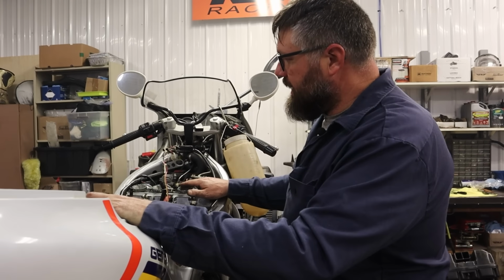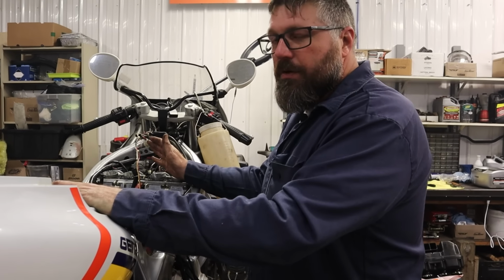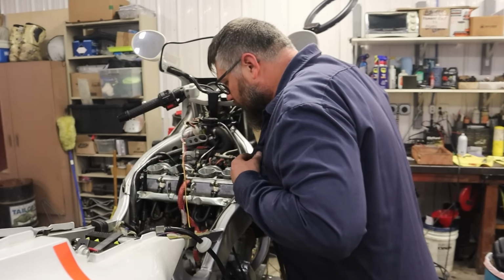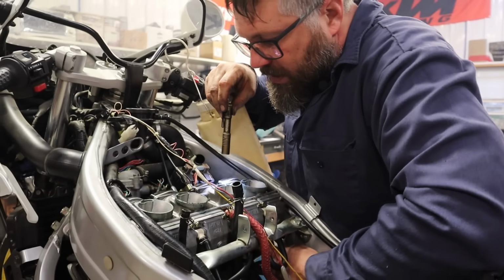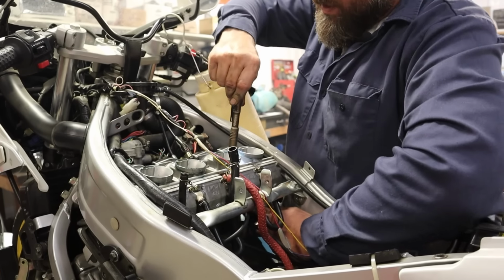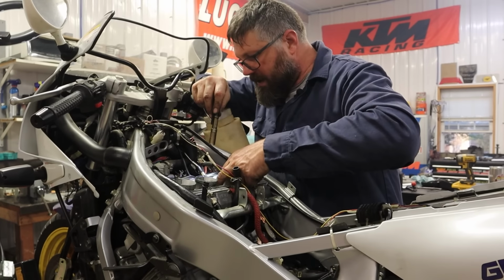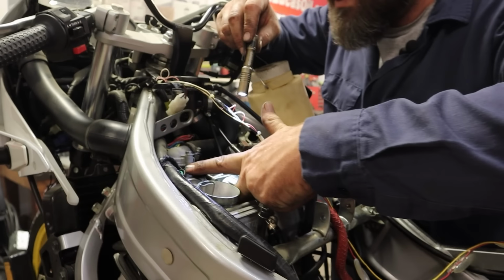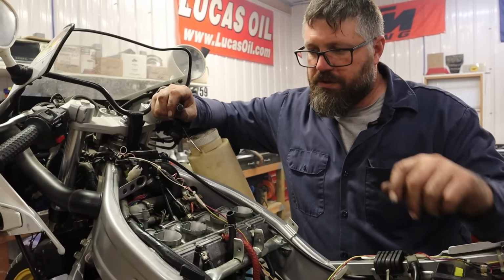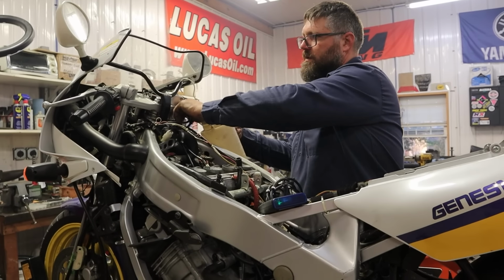And then the way you sync it is, one is your base. One carburetor is gonna be your base carb and you sync the other carburetors to that base carb. And they're generally little screws like this one here is underneath. So there's actually a screw in under here. I don't know, you can't really see my finger, but you can see that plate with the spring and there's a screw. So it'll sync this one. Right here's a sync and then there's one here. So four carburetors, three sync screws because one's your base. And that's pretty much how you sync a carburetor.